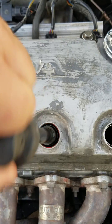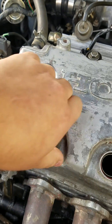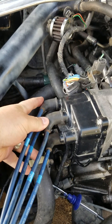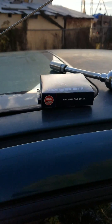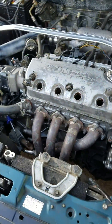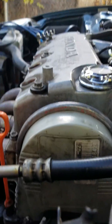I'm going to take off all these wires and then grab my tools. Here's spark plug two — remove that. Spark plug three, and spark plug four. You're wondering why I have these wires laid out right here? It's very simple. If you take them off from the distributor and don't make sure of which order they go, you're going to have a misfiring problem — it's not going to fire correctly. Now we're going to get our nifty tools. For the swap, I'm going to be using NGK Iridium. NGKs are recommended for Hondas. Do not use E3 spark plugs in a Honda Civic — I cannot stress that enough, it does not work right.